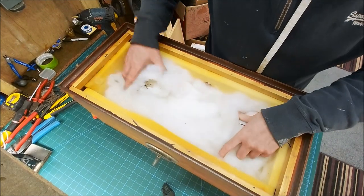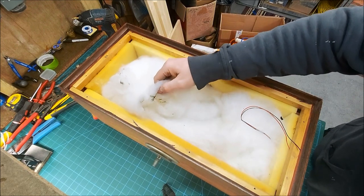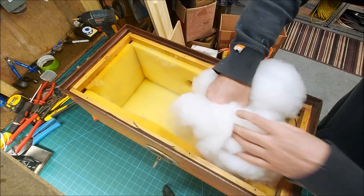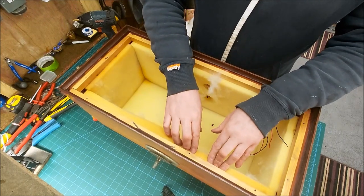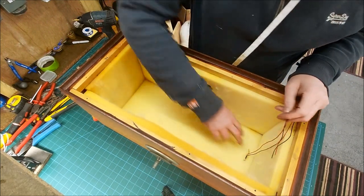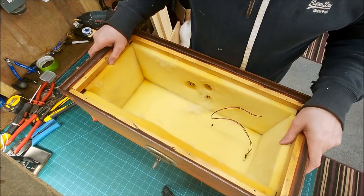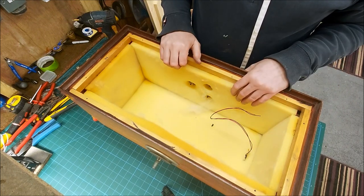Let's have a look at the cabinet. A lot of heat damage had happened in here - lots of burning. So much polyfill in here - I don't think that's original. I don't think these were full of this to start with. Typical bitumen pad - lossy BBC style cabinet. So we're going to retain that, get these brackets off the side, and then rewrap the cabinet. We can build everything on our front baffle and then drop it in. That's pretty cool.